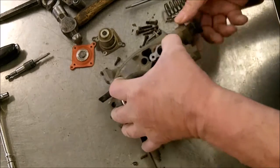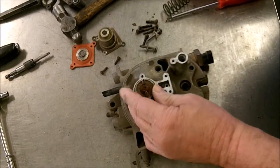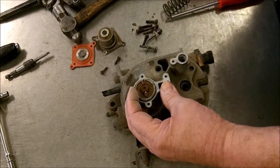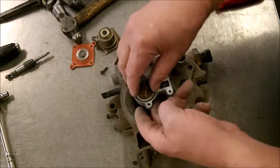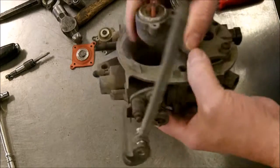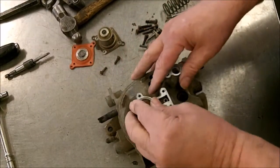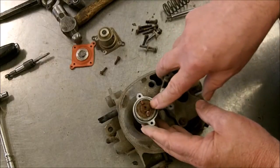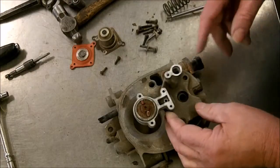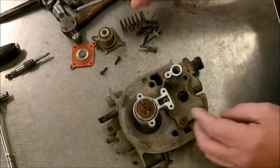Now these should generally have new bushings put in them, so if you're doing this yourself and you need new bushings, then I can recommend somewhere to get that done. We'll have to find a way to pry this up. You never want to push this out through the bottom. You'll damage it. This will have to be cleaned and rebuilt, and we will have reman units that'll fit these. If you want to just send your old one in as an exchange unit and replace it with that, we can help you out with that.